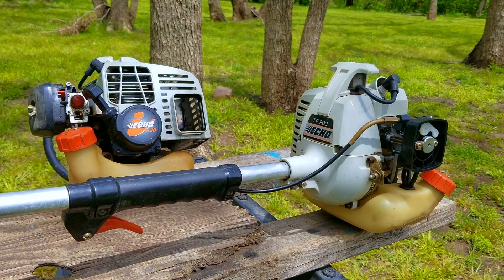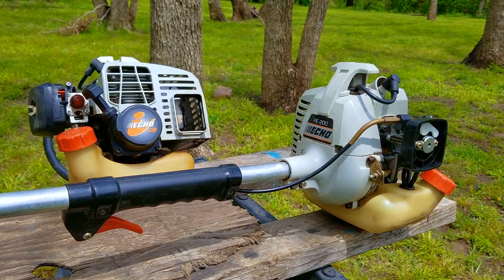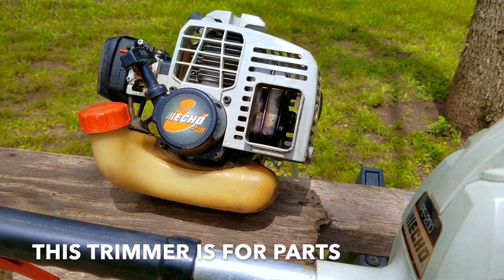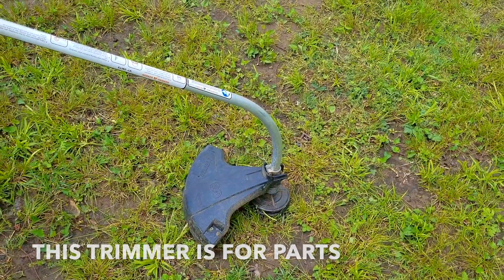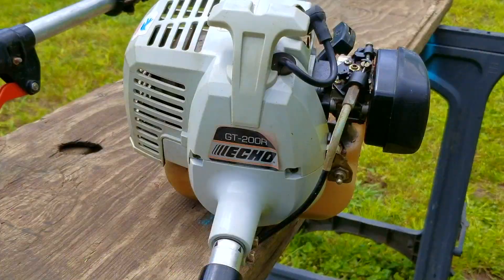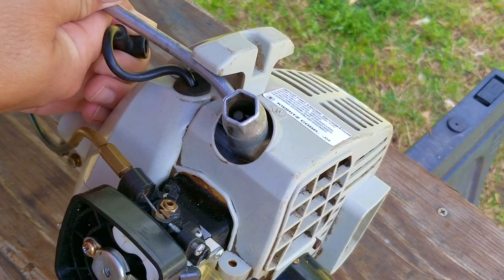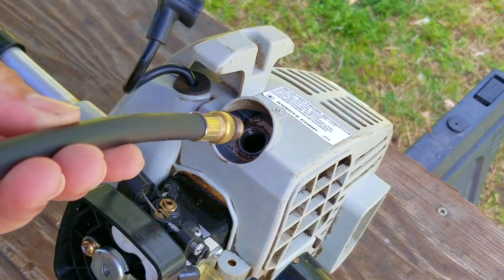In the previous episode on this edger, we cleaned and serviced the carb, and I also replaced the fuel tank grommet, but after getting it started, I wasn't able to get it to run like it was supposed to. I then used my old compression tester that I've had for a very long time, and it showed that the engine was low on compression and would need a full rebuild. It's a shame because that bad compression tester may have misdiagnosed a couple of engines before I realized it. The testers are very fragile, so if you think yours might be giving you bad readings, there should be a link in the description if you need to buy a new one.